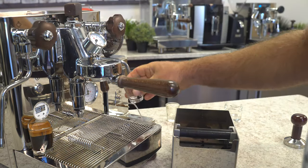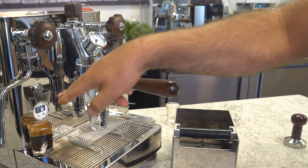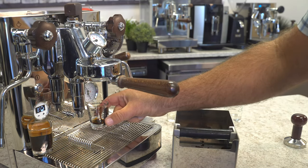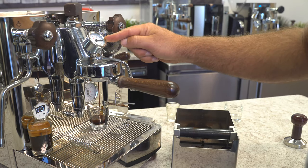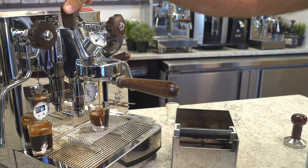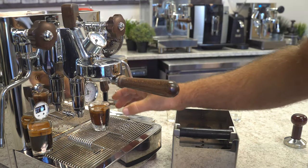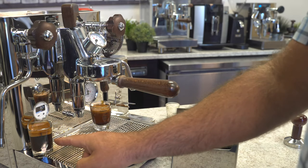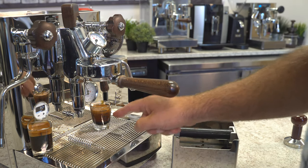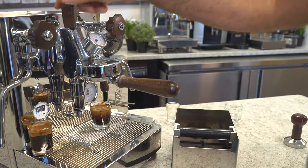That's the machine refilling fresh water into the steam boiler. Now we're going to lift up the shot clock again — five seconds. Nice little drip right there. With the finer grind, we're almost at 11 bar. If you want the nine bar, bring the needle valve down, paddle a little bit over, and we're at nine bar. It took a little longer than usual, but I wanted to show you the effect. We're at 27 seconds. The crema is amazing — the shot I pulled a minute or two ago still has crema on top. We have a nice Guinness effect. This is how you adjust for nine bar of pressure.